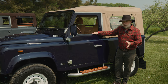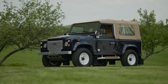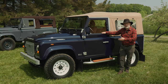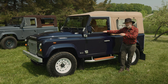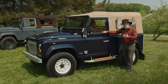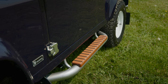Looking at this one, you might think it's lifted — but it's not. It's a 235/85/16 on a modular Wolf-style wheel that gives it a heavier stance and almost a lifted look. It has not been lifted; I just wanted a rugged appeal. That's a KO2 tire — I generally do a KM3, but on a soft top of this style to make it flow, I went with the KO2.